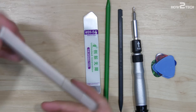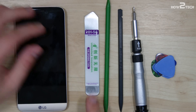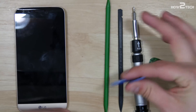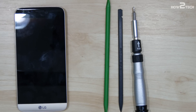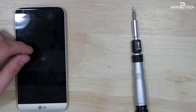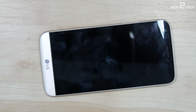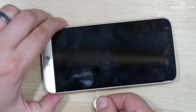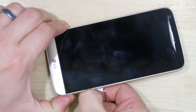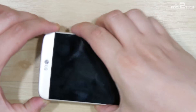Hey, what's up everybody, HowToTech, and we have an LG G5 to go ahead and pull apart for you today. Here's a few tools: a couple opening tools, trying to stay away from this metal tool as much as possible and use these guitar picks. We have a couple of pry tools and a small Phillips screwdriver — this is a triple zero. We need a SIM card removal tool, so we're going to pop this in and remove the tray. This will be the screen disassembly, so we'll be using a heat gun as well.